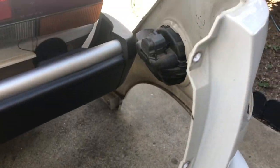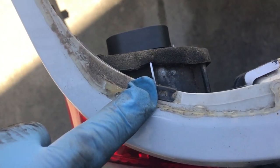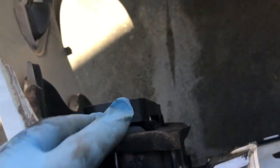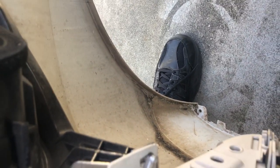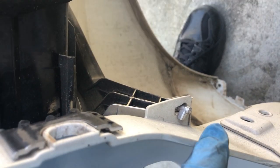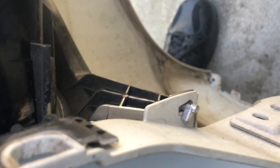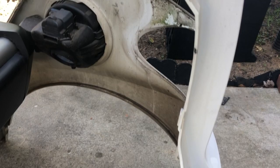There's a little door you can get into, but there's a clip that holds this on — I wanted to point this out. There's a tiny little clip that you use that holds this taillight assembly in. You can see there is the locating clip right here. When you're ready to install it, you can see where it comes out, and the taillight assembly sort of pivots backwards — that's how you get that in there. So be careful not to break it, but it's a pretty easy job to take this apart.